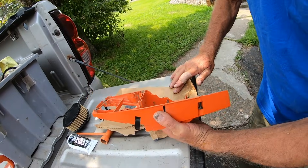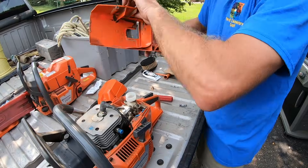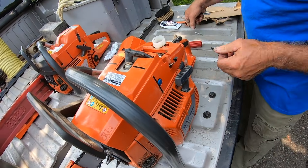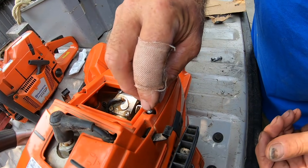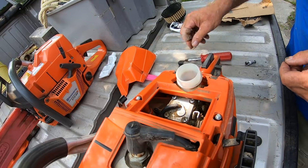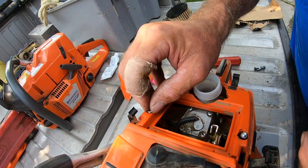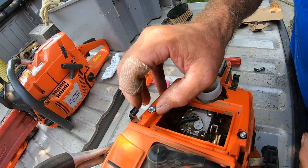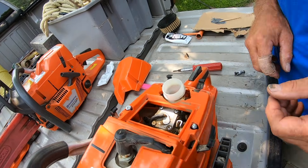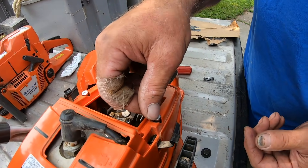I'm putting grease on the cover so the JB weld doesn't stick — we don't want JB weld on the cover because you'd have to bust it. I asked Ken when the camera was off — JB weld is actually stronger than aluminum. I was worried about it not holding as well as the aluminum did, but apparently it's actually stronger. So now we're gonna get the studs down in there — right on the right, left on the left.